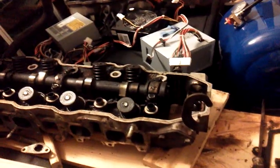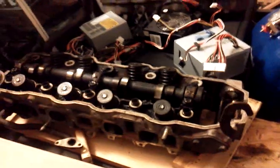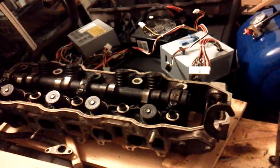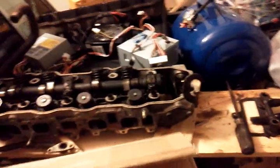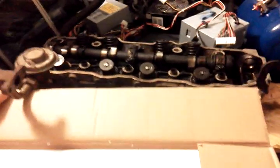Okay. Well, that's just having the head done. The gaskets, the good gasket set with a head gasket and all the gaskets you need to redo this, was going to cost me right at $100. So I got on eBay and I ordered a new head, which came with all of the gaskets. It came with new head bolts, which on these motors you have to change because they do stretch when you install them. Some people I know reuse them, but I'm changing mine just to be on the safe side. I don't want to break one off and be having to deal with that.